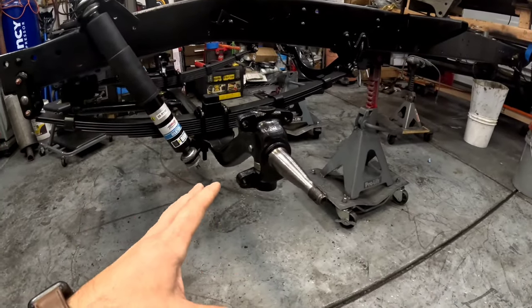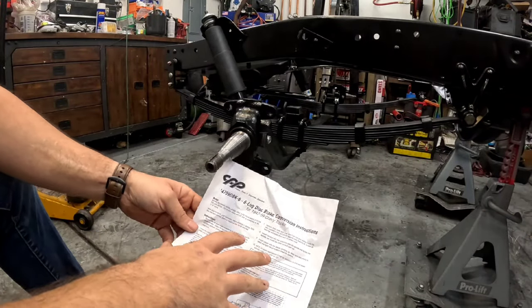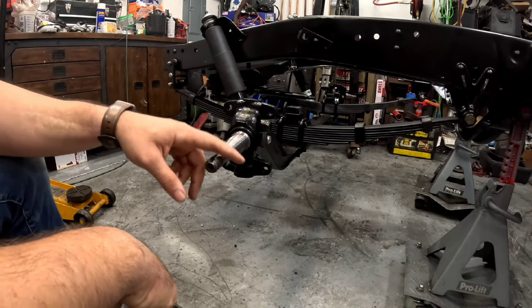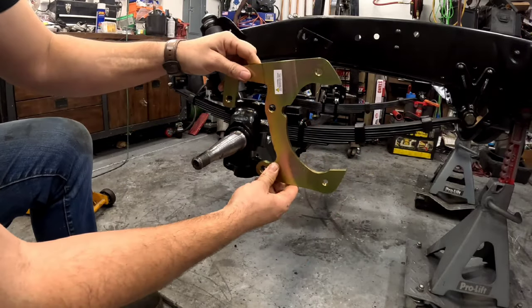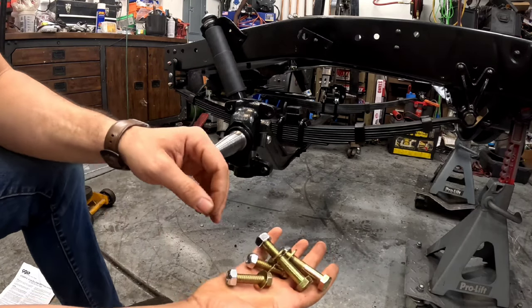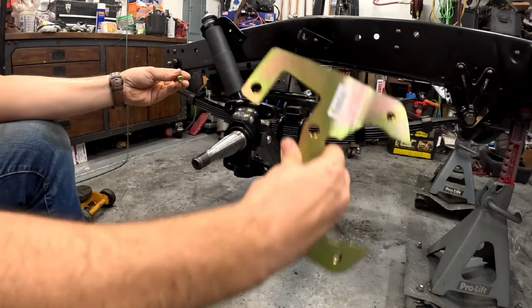Now this is the same spindle except everything's nice and painted. What we're going to do is get our mounting bracket on and start putting this kit together. Following the instructions, it says to test-fit the bracket and caliper for fitment first. The bracket goes on like this — the part that jogs back faces outward. The bolts come in three different lengths, and since the steering arm bolts to the back, I'm guessing those use the longer bolts.